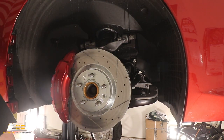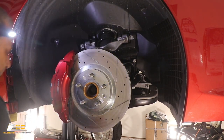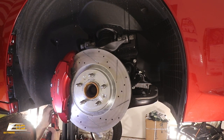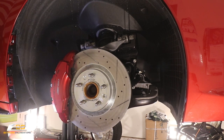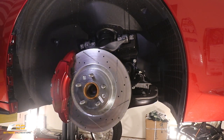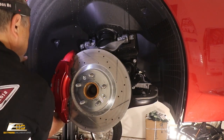There's a couple 7mm screws that are right here. So let's get these little guys. They're right here at the bottom. So this wheel liner is in there with a lot of screws. All right, so now we got those done. And those two screws happen to be the same length as the screw that holds the rock guard in, so you don't have to worry about those getting confused with those.